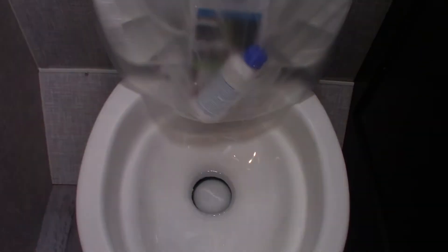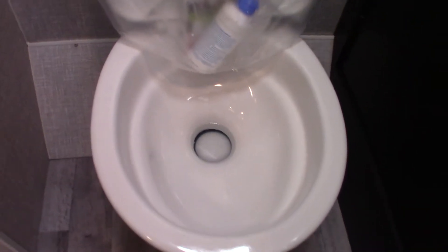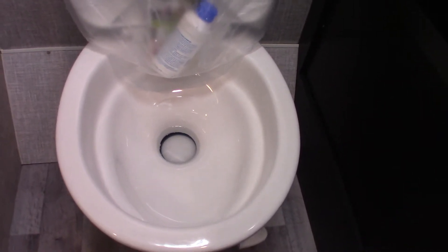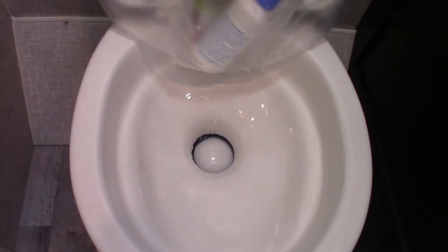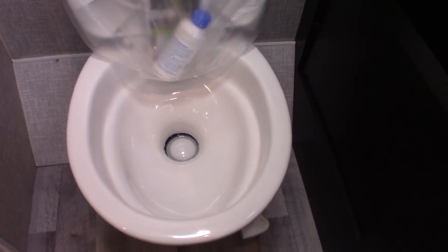Now we go into the bathroom here. It works like any other bathroom — sink and shower, of course. This is an RV toilet. This is the flush pedal here. The black tank is directly below. You have to have chemical and water in the black tank before you start using it. So when you pull into the campground, your tank has been dumped already. Go in, put one dose of chemical in the bowl, step on the flush pedal, and let a gallon or so of water go into the tank. You've got to have chemical and water in there before you use it, otherwise the smell will be terrible.